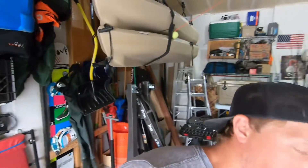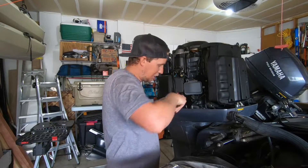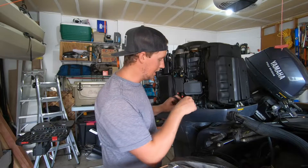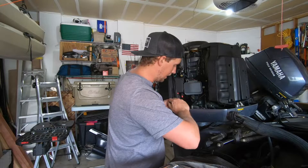After the cables, we need to start disconnecting the power. Before you touch any electrical stuff, make sure you disconnect power. If you have a main battery kill switch, flip that off — I've just done that. If you don't, disconnect it from the battery. As much as you can help it, don't move these cables around — just disconnect them and don't twist them, because they're already set and you won't have to go back and reset everything.